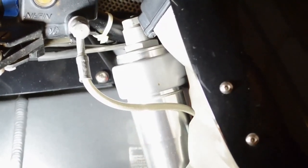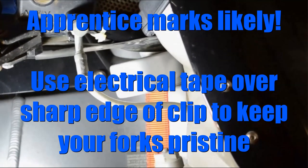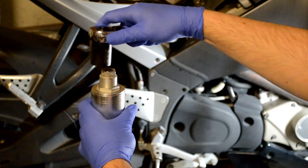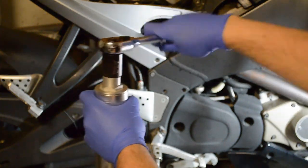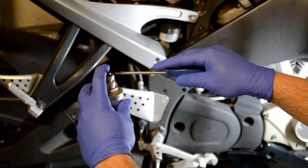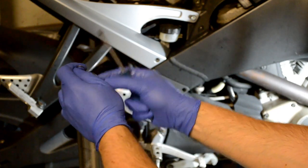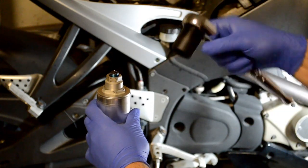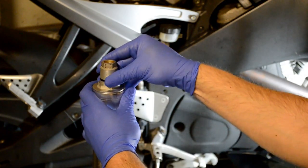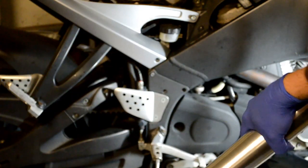Remove the retaining ring clip before you get to the bottom. You need to screw down the adjuster nut to access the ring clip. With your finger over the ring so it can't fly off, go ahead and pry it out. Unscrew the adjuster nut until it comes out. There's going to be a washer right there — make sure you don't lose it.